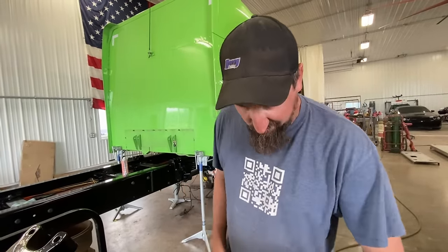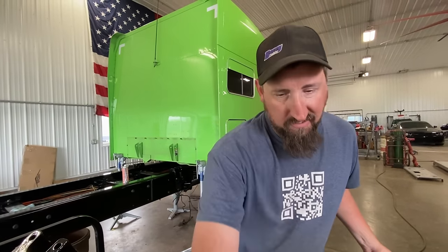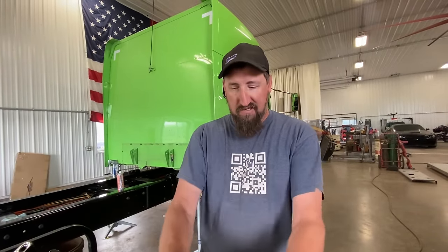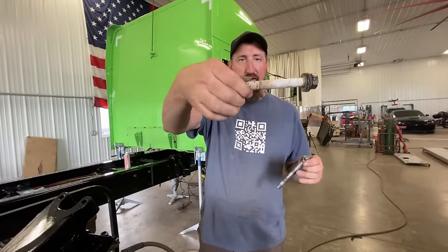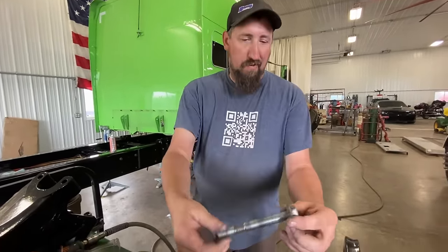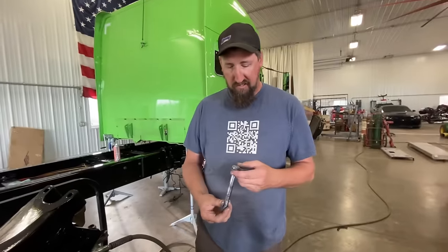I'm going to show you guys a little trick. It's not even a trick. It's more common sense. You can anti-seize this. We cleaned all these up, took this crap off, the white electrolysis is what they call it. We cleaned them up on the bench grinder with a wire wheel. You did such a nice job. I did, cleaned the heads up.